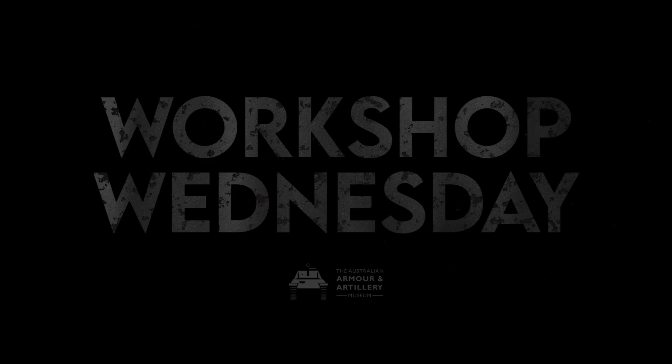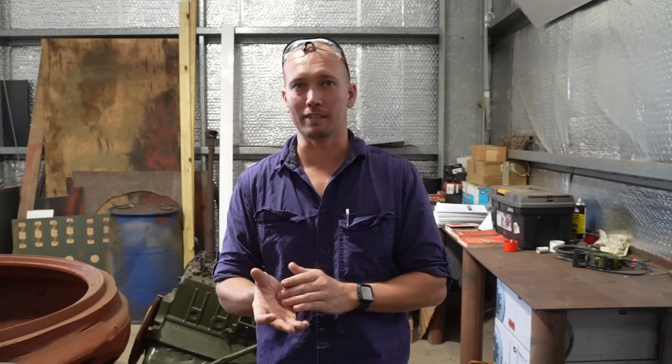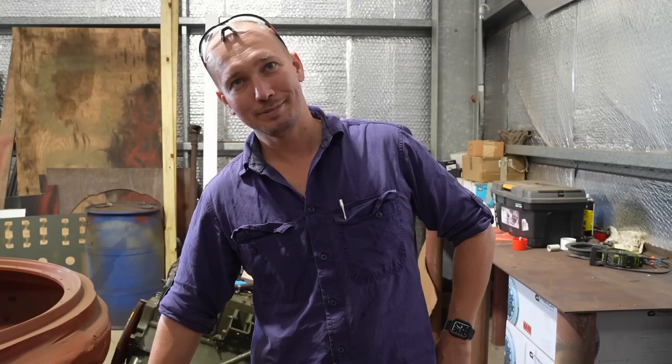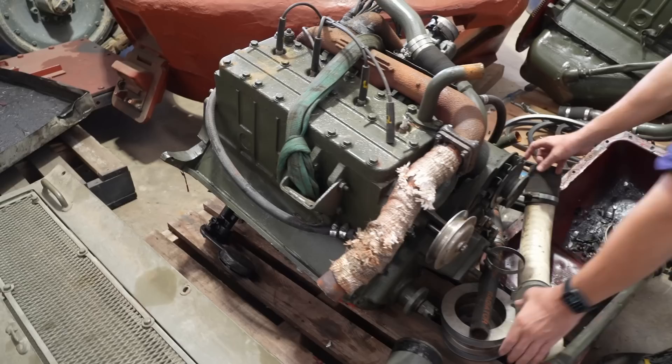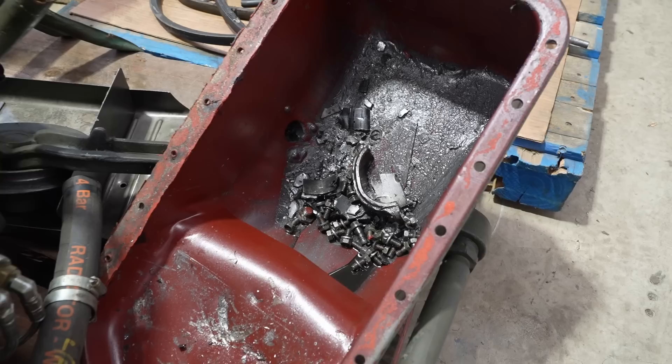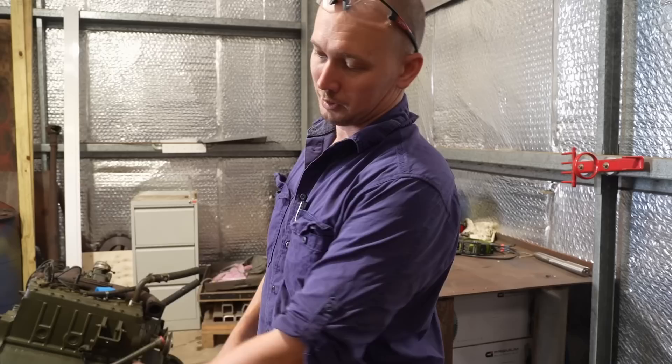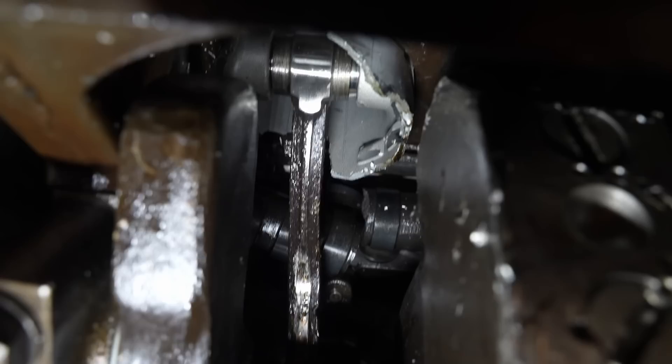Our M5 Stuart is a terrific exhibit but we've been having a little bit of trouble with it lately. One engine would crank and start and the other one had either a starter motor issue or the engine was seized. We brought it over to the workshop and tried to turn it by hand — no good. So we removed the oil pan, the sump, and found bits of conrod and bearing. A conrod had let go; looks like the big end cap let go at the bolts, and the conrod came around, wrapped itself around everything and smashed it all up — smashed the camshaft, smashed the block. It's done a lot of damage.